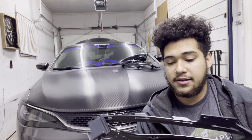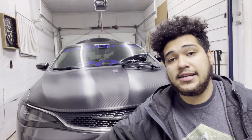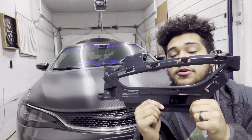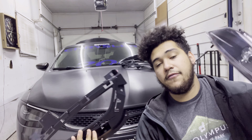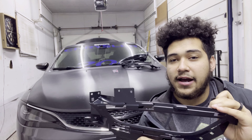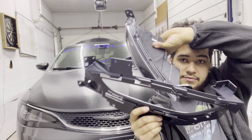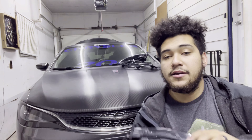First off, what you're going to need — I'll use the passenger side as an example. If you have a Limited or any trim that doesn't have fog lights, just that black plastic piece with no fogs at all, you're going to need this bracket. My guys with the single-bulb fogs do not need this — your car already comes with it. This is the bracket that holds the new fog light. It comes in pairs; link in the description, about $35 to $40 from eBay, ships in a couple of days.